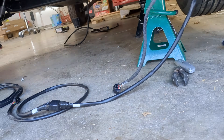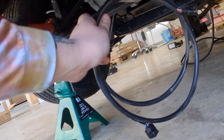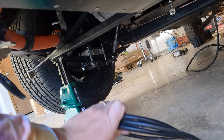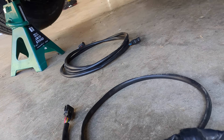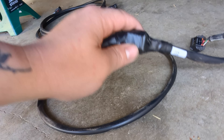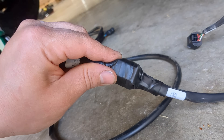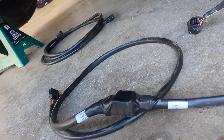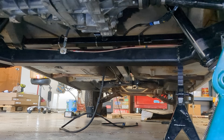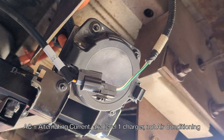I'm getting the wiring harness installed, and the cool thing with this Resolve wiring harness is it came with all these extenders — two two-meter extenders and two one-meter extenders — so you can adapt it to exactly what you need. For me, I'll need three meters of extension for the PDM and three meters for the inverter. I'm also wrapping them in electrical tape just to help keep them a little more watertight. It also came with wires for the CHAdeMO port and for the AC charging port, the level one port.